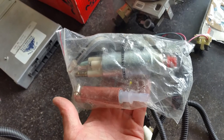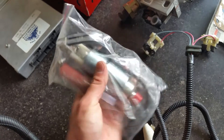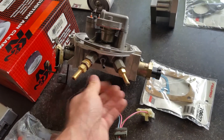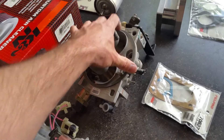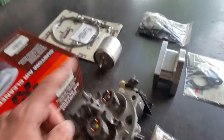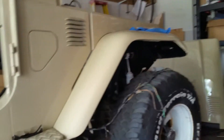There's a website — it sounds super generic but it's pretty good — it's like fuelpumps.com or Walbro Fuel Pumps. You can get the fuel pump just for TBI; it's a lower-pressure unit. There's actually a fuel pressure regulator built into the TBI itself, so it's self-regulating and you don't even have to run a separate fuel pressure regulator when you do the conversion. You just need a fuel filter — you can run one of these plain-Jane inline filters. Just go from the fuel tank into the filter, into the pump, and then up into your motor.